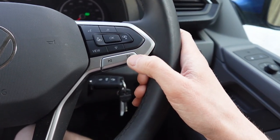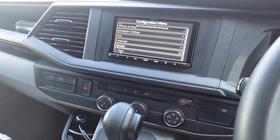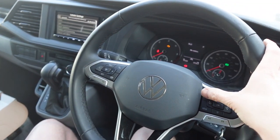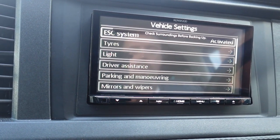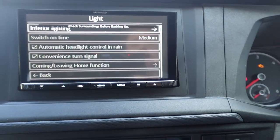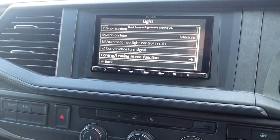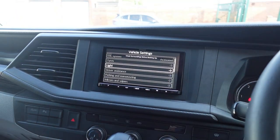Using the skip buttons, we can go down the options, and when you want to pick one, you push the voice button to enter it. So now I can go into vehicle systems — I've got access to the traction control, tire pressure monitoring, light sensors. For example, you can choose the automatic headlight controlling range. You don't want to lose any of these settings when changing the radio — it's very important these are retained. All operated from the steering wheel controls as opposed to the touchscreen on the old unit, but it still works and the customer's got all the functionality.